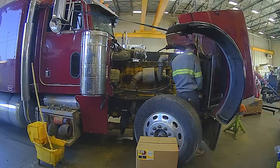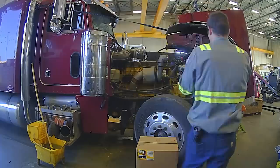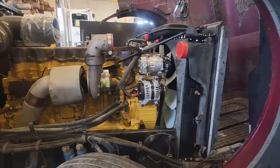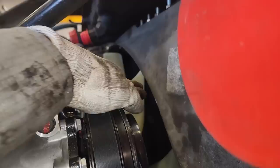Getting back to what I'm actually doing here — we're installing the radiator assembly, and it's kind of a pain because you have to install the radiator assembly and the fan at the same time. You can't really install the fan after or before. This did lead to a small holdup: the fan was too close to the shroud. The mount bolts don't change, but we just shifted the shroud as far as it would go to the right, which gave us about three-eighths of an inch of gap. These shrouds are actually surprisingly expensive — the last thing you want is a brand new fan hitting the shroud and destroying it.